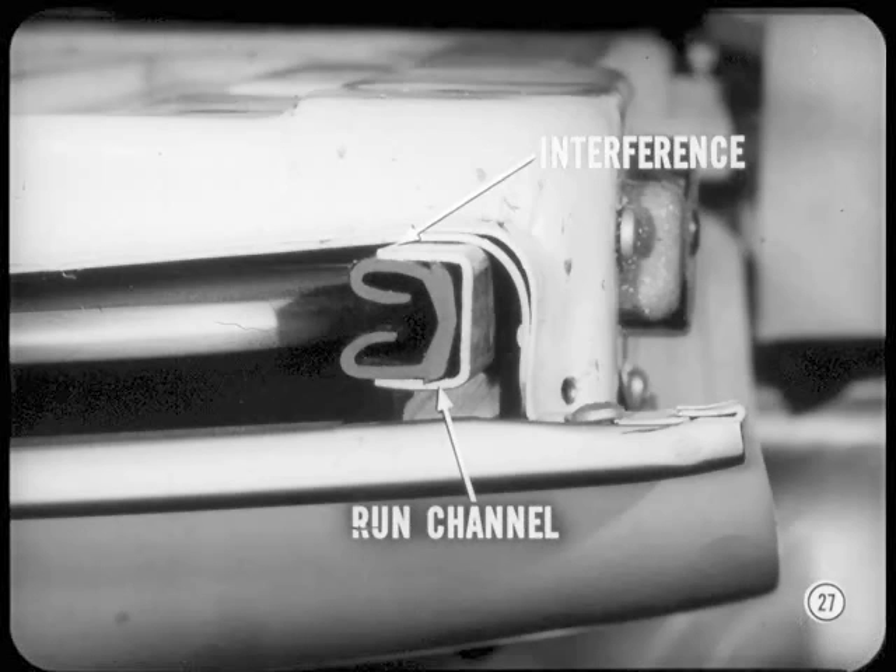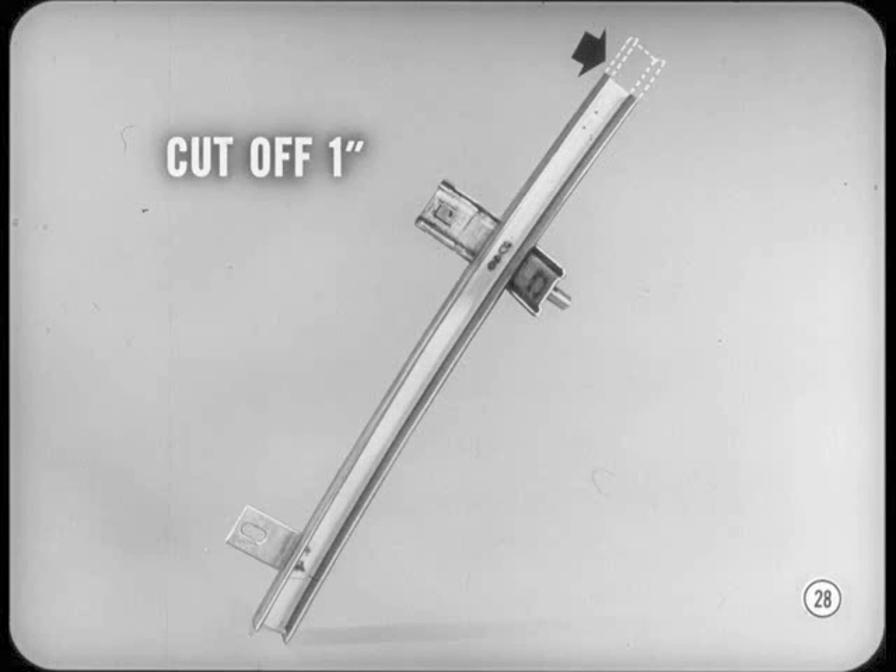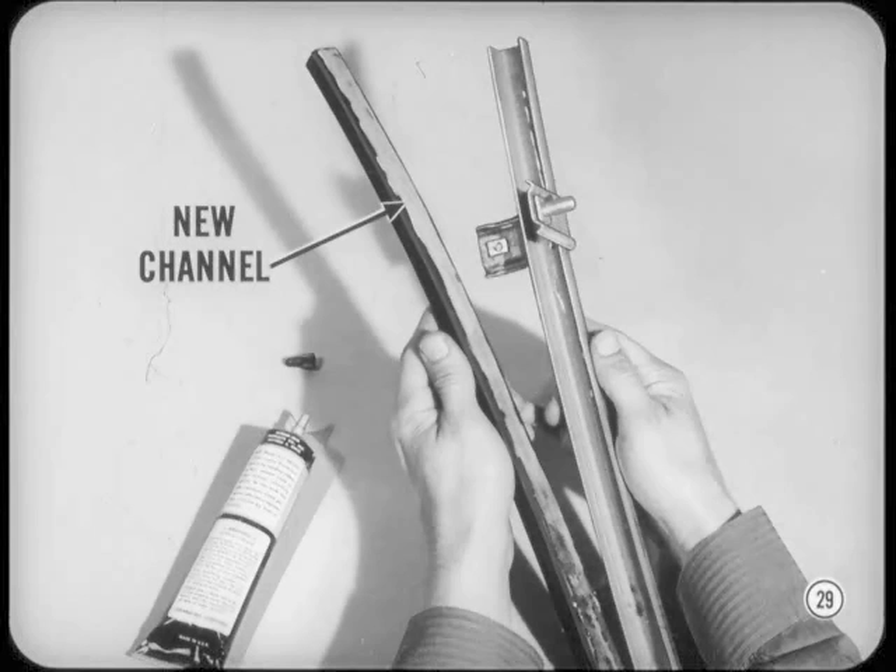Speaking of interference, on some early jobs, you might find that the upper ends of glass run channels can't be adjusted far enough forward. If so, remove the glass assembly and both glass run channels. Cut or grind off the staples that hold the glass run rubber channel and remove the rubber. Rework both metal channels by cutting about an inch off the tops — that will eliminate interference and allow extra fore and aft adjustment. Install new glass run rubber channels using a two-coat cement application, then reinstall the reworked channel assemblies in the gate and adjust them.